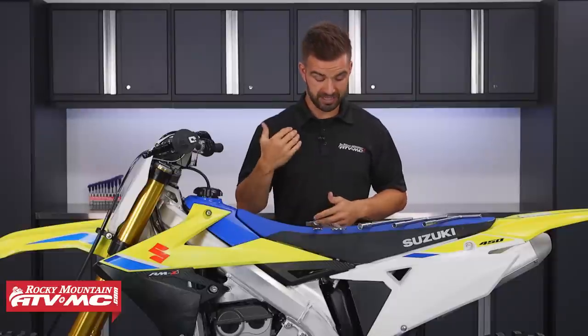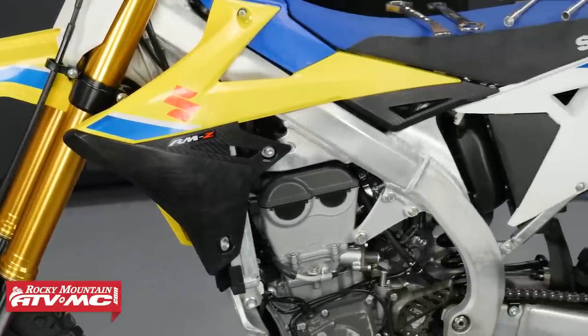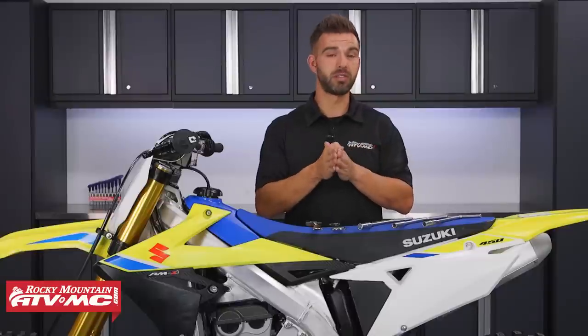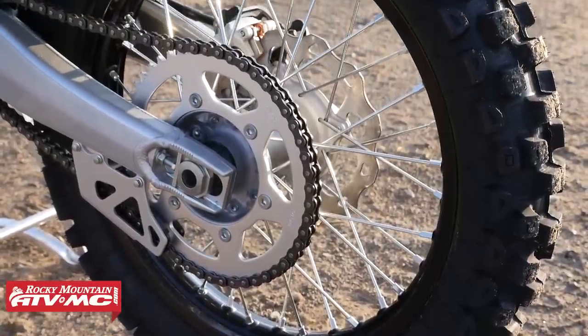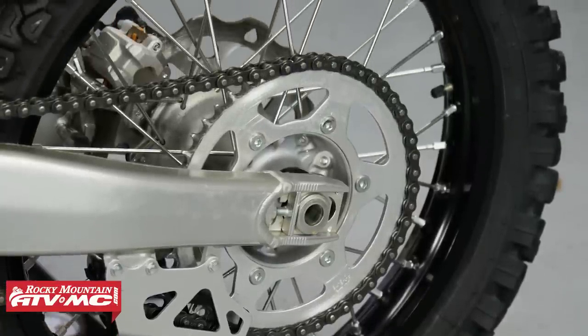It's really important because I've seen a lot of things come loose and come off motorcycles and ATVs while people are riding. I've seen kickstarters come off; I've literally seen a rider have his rear axle nut fall off and his axle come out — that did not end well. If you recently installed a new sprocket, you want to make sure you have Loctite on the sprocket bolts and pick up new bolts and nuts. I've seen those come loose and it does serious damage to your hub.